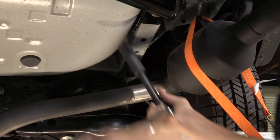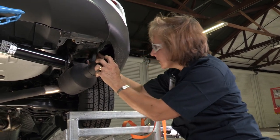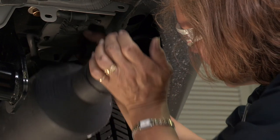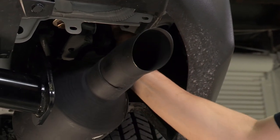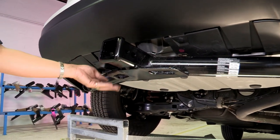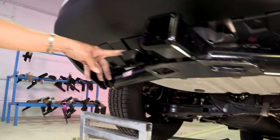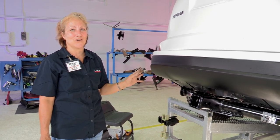And that's it — we now have the muffler loose. We have to get our muffler hooked back up. Just dab a little bit of soapy water in that little hole there, raise your muffler into place, and slide it over so that it's secured again. This is our two-inch receiver, with a five-eighths hole for our pin, two brackets for our safety chains, our ratings, and the bracket for our wiring harness as well.